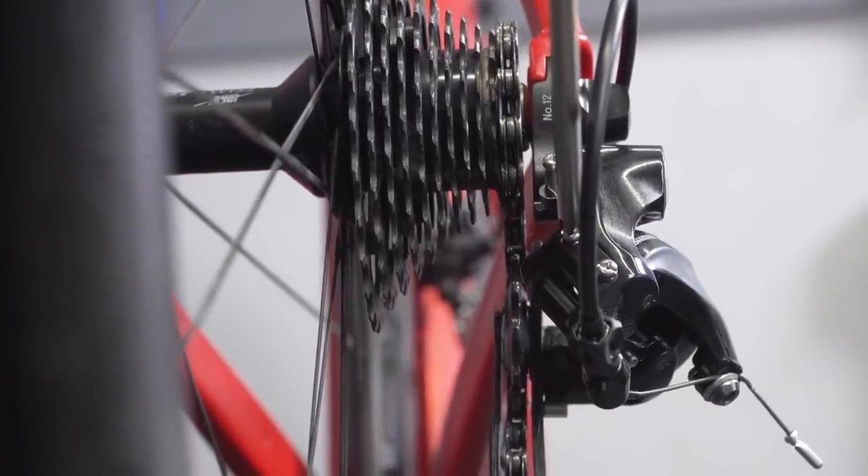Next is Kick Butoski, who has a problem with their rear derailleur. When shifting into the lowest cog at the back using a normal cadence it doesn't work, but when RPM is above 100 it does work. I hope it's not the cadence itself, but it could be that at 100 RPM you're putting a little more pressure in, giving the rear derailleur just enough extra flex to move into that sprocket — which isn't good. Take a look at the rear derailleur adjustment screws, and importantly, do it with the rear wheel tightened up as you'd have it when riding. A lot of people don't tighten the rear wheel enough in a work stand, and when they tighten the skewer out on the road it moves the derailleur. Also check the derailleur hanger is nice and straight.